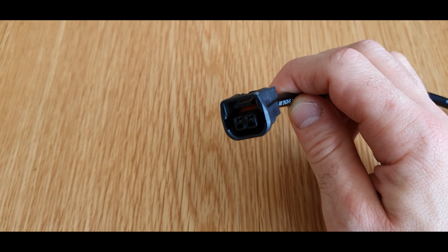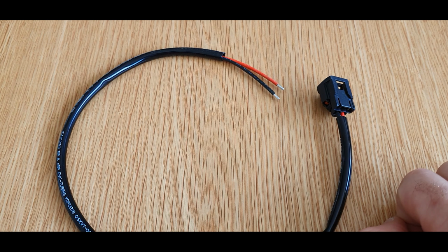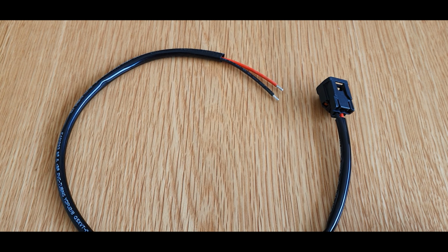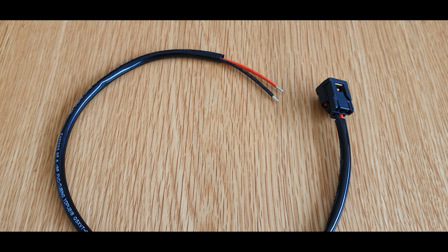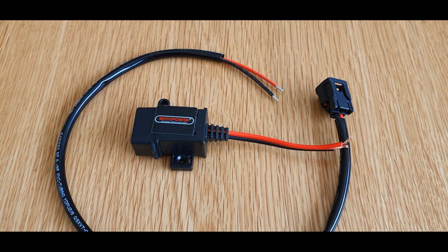Okay, now these adapters you can also get on Amazon. I'll leave a link in the description below because they're very useful. The auxiliary power supply basically means that when I cut the power, there's no more power going to the charger, and it's also fused. And this seems the most seamless and correct way to charge a phone on my bike. So now I'm going to crimp these guys together and attach them to my bike, and I'll show you how to do that downstairs.